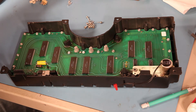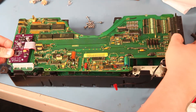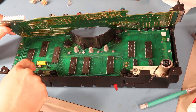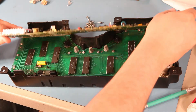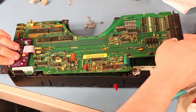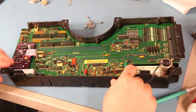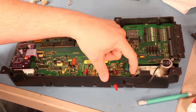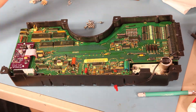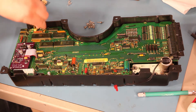After you've completed the bulb install, we'll replace the top board. Make sure that the 12 pins here are lined up with the 12 holes in the top board, and then gently press that connector into place. There's also an alignment pin located right here. Next, we'll reinstall the seven screws that hold the top board in place.